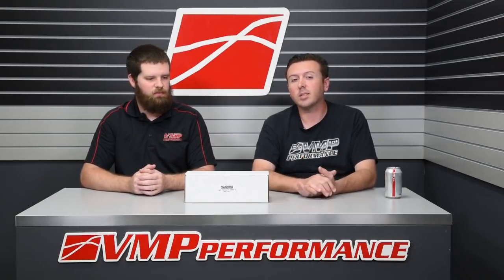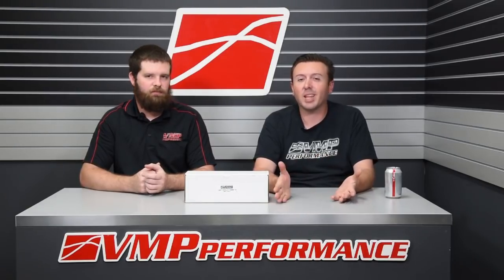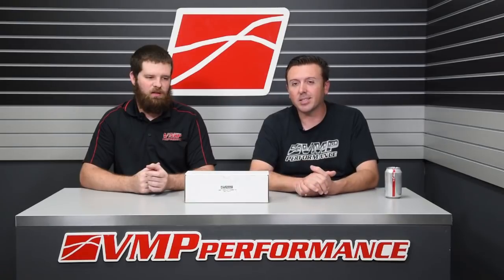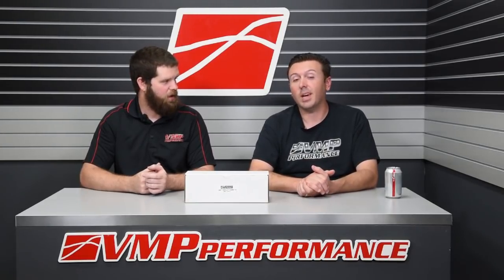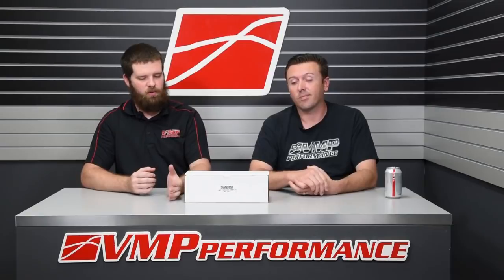And the supercharged cars always dyno a little better when they have long tube headers, but it's not like 50 horsepower. Like Joe said, a lot of these long tube setups, you're into them $2,000, $2,500 by the time it's all said and done. That's a pretty high dollar per horsepower figure if you're already boosted.